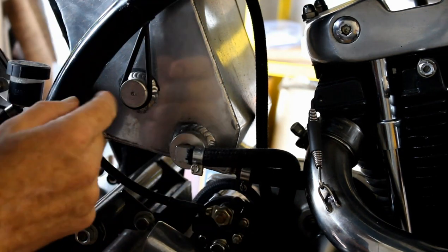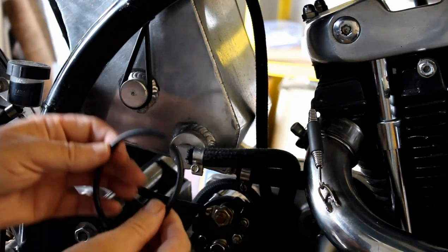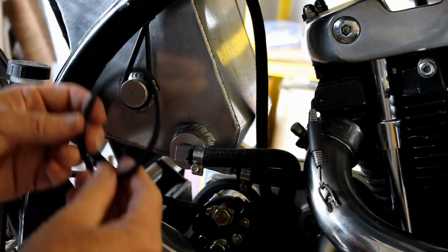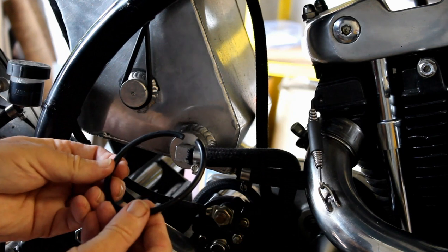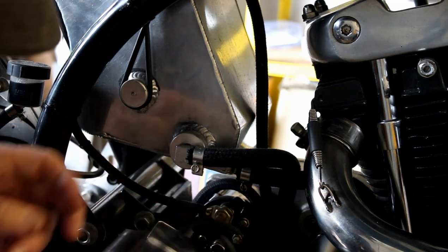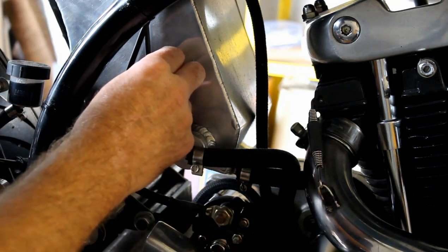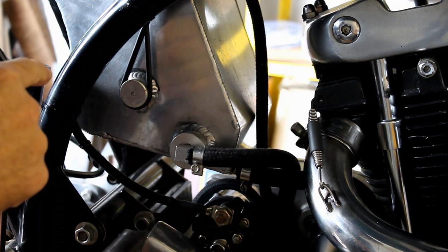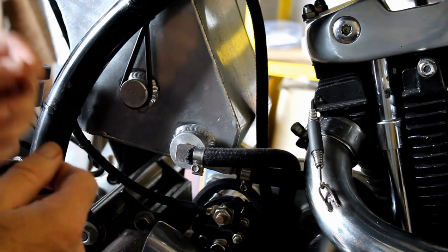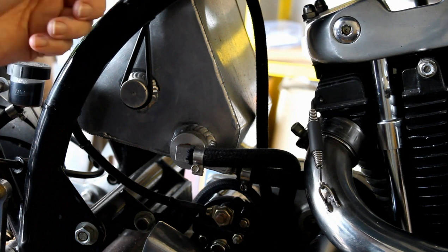Moving on, the next small irritating problem concerns this O-ring which I use to help support the oil tank. The problem is they break — here's one I just changed, and luckily I've got a bag of about ten of them. These are O-rings made to be strong in compression, not in extension, and I think that's why they break. Even though they're quite thick, they don't last long when stretched like this. I had an idea of using a zip tie so I can adjust it just right.